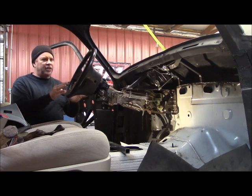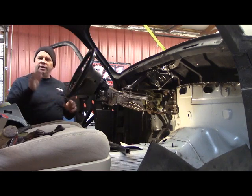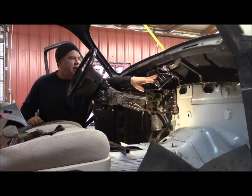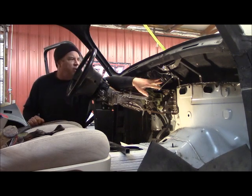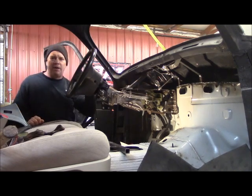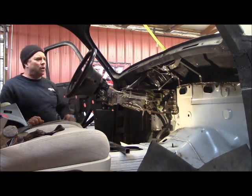I'm going to get in here and finish up this dash. I've been doing a bunch of work on it, worked on it a bunch yesterday. There's a lot going on in here. You saw where I was making your wiper system. Now I've got your wiper system installed with your opposing system on your original Explorer motor that will plug right in. That's going to operate off of your steering column and it's going to have delay. Not sure if I can hide the squirter in there, but if I can, that'll just be a bonus — it'll all work just like the Explorer.